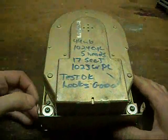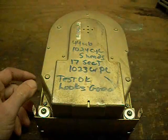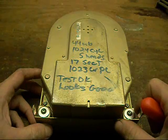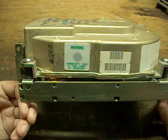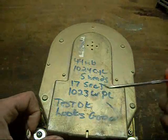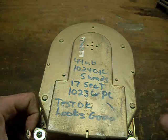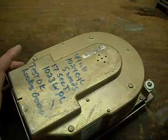The problem in this case is what's called servo track fade, or servo fade. In other words, the actual permanently laid-in tracks that tell the head positioner where to move have faded to the point that the drive can no longer read them. These older MFM and RLL drives normally used a dedicated platter — usually the top or bottom platter — to store the servo information, while the other discs were strictly data discs. In this case, five heads, meaning a total of six heads with three platters, yet only five heads were used for data and one head used for servo.